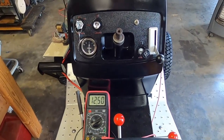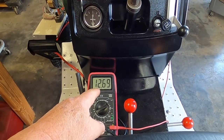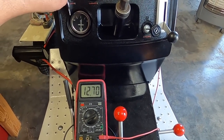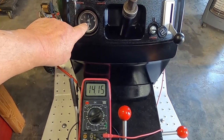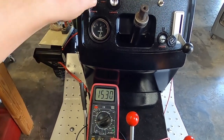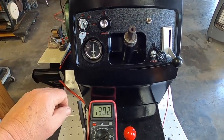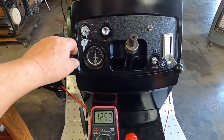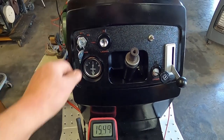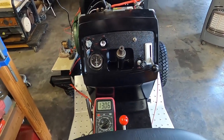Hopefully this is the last test for electrical — 12.6 volts. Watch the amp meter — key on. Yeah, it's pointing the right way now. So all that's verified. We can check the starter relay now. Got to push the clutch — well, it's already been checked, we know it works.